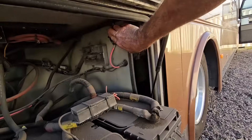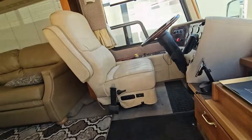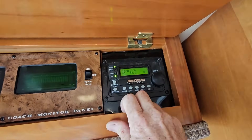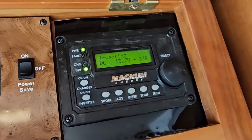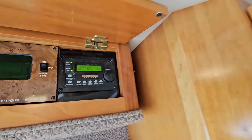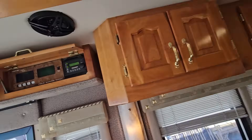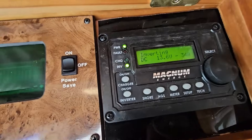If I trip the solar from working and come inside, the battery voltage on the inverter is 14.2. I can turn the inverter on, and with the refrigerator going and the 110 lights on, that battery is still doing pretty well. Let's take a look at the information on the app so you can see what we're talking about and how many times I've cycled the battery.